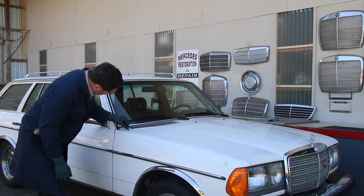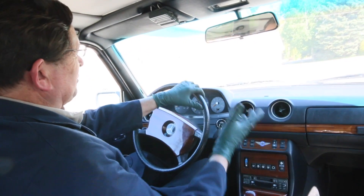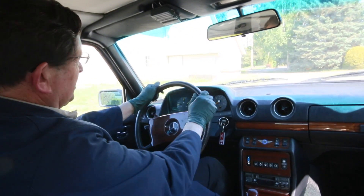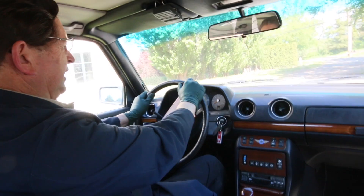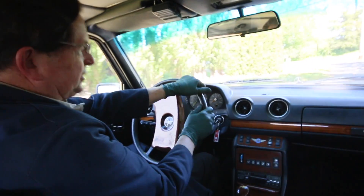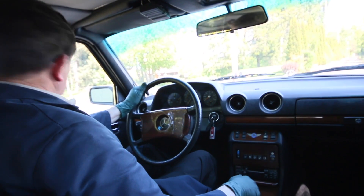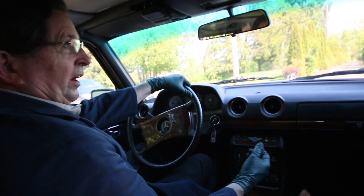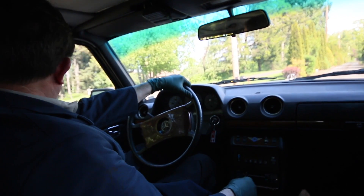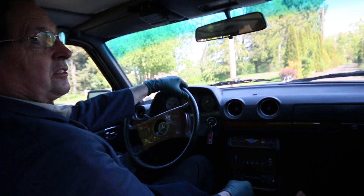I still have looseness on that hose. Now I'm going to get in the car and hit the road to find out whether or not this turbocharger is working. Along with the turbocharger, I'm also a little concerned about the operation of the EGR valve — those two working improperly can cause weird smoking issues with a diesel engine. But first I want to make sure the turbocharger is producing boost pressure. If it's not, I've got to tackle the turbo. But if the turbo is working okay and I'm getting at least eight or nine PSI of boost under load, then I can go after the EGR valve, the overboost circuit, the ALDA, and the banjo bolt that can often get plugged and gives positive pressure to the ALDA.